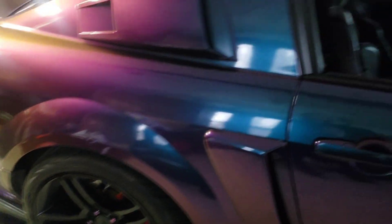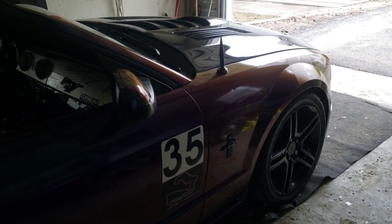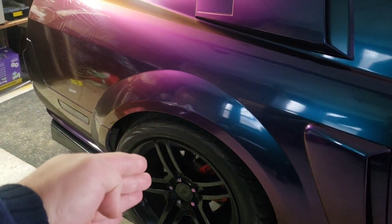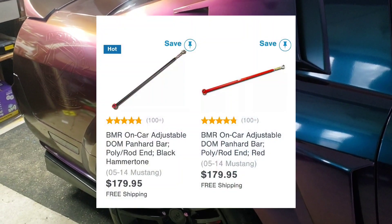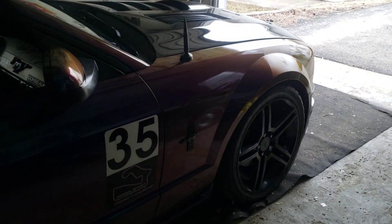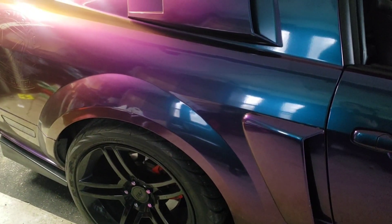These are under $300 — maybe you might have to spend a little over. What I am running on this car are the BMRs. And speaking of suspension, since we're running that route and you're lowering this car, you might want to get a Panhard bar. What I have is a BMR adjustable Panhard bar in the back. Once you lower it, best bet's a Panhard bar. I'll leave that photo up as well so you guys can get an idea. I would recommend — if you guys do decide to lower your car — throw a Panhard bar on there as well.